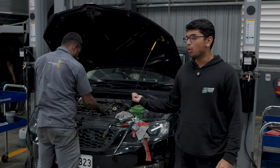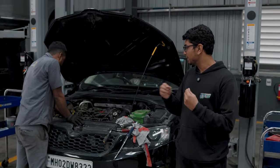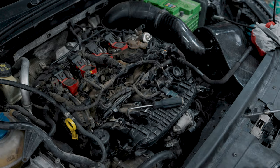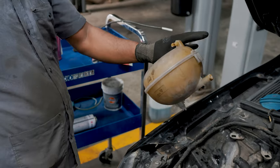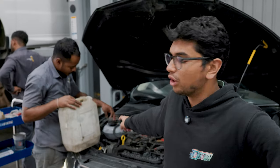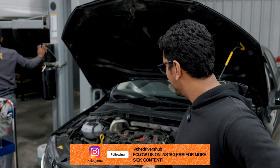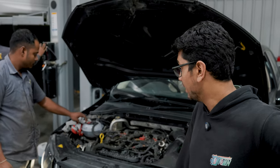I think we're more or less done. The new water pump and the new joint from the water pump to the oil cooler have now all been fitted, and once we put on a couple of couplers we'll see what happens with the car. The new coolant tank has also been installed and we're just putting in some water to check the whole system and figure out if there are any more leaks. At least till now we're not seeing any water falling down — whatever's on the ground is just overflow from the coolant tank. Fingers crossed.